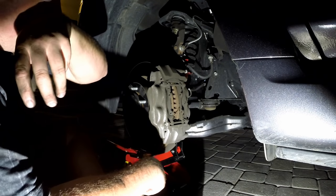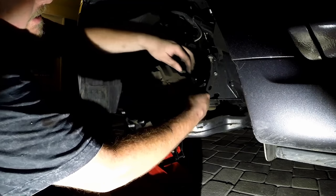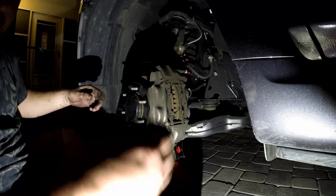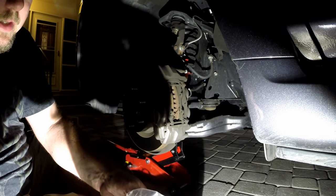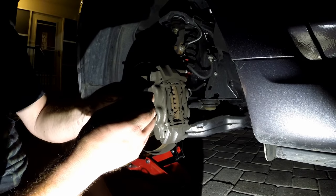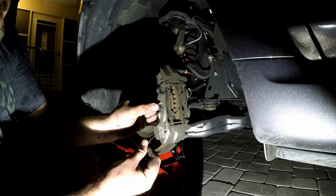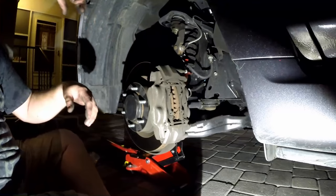In order to remove the pins, we start by pulling this guy out, then this guy out. Move the ends of the pins — it comes right off. Now, the Power Stop brake kit does not include another one of those long pins. It includes two cotter pins. Instead of this long thing, we are going to put the cotter pins back in. I like cotter pins better.